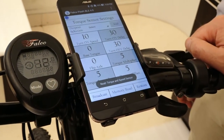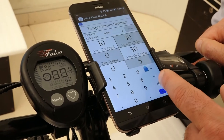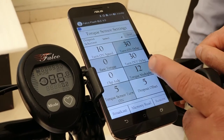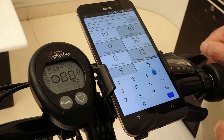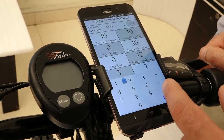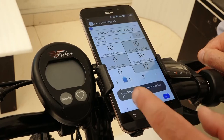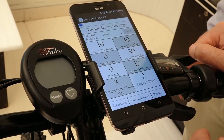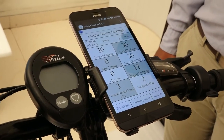Memory read successfully — it now reads torque and speed. When I want to make the torque sensor very sensitive, I normally increase the sensitivity by setting my torque multiplier to 12 — that means my effort is multiplied 12 times by the motor. I can also make it more sensitive by setting the dropout offset to 2, and reducing the torque sensor turn-on value to 3. These settings — torque multiplier 12, dropout offset 2, turn-on value 3 — allow for an extremely sensitive torque sensor, so with little effort I can get a lot more from the motor.